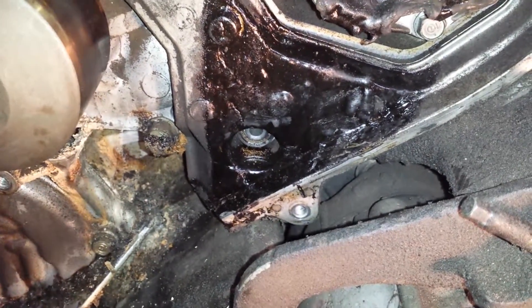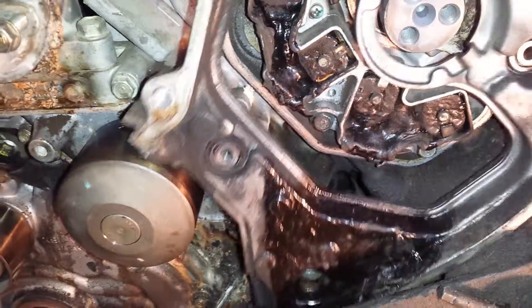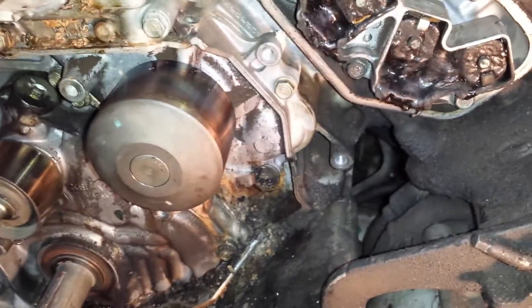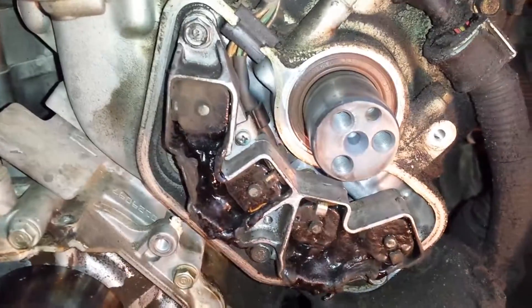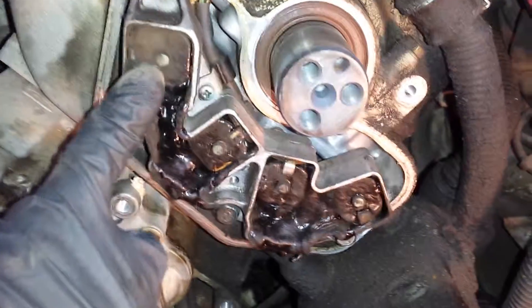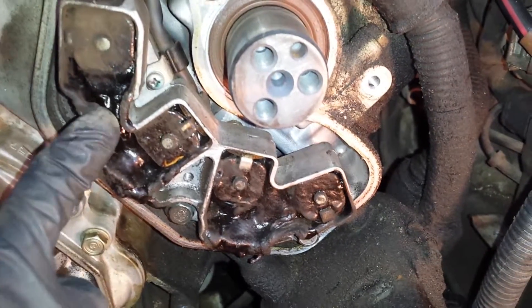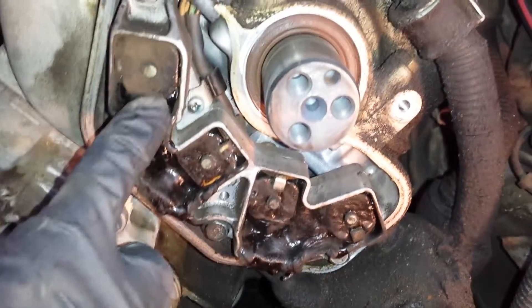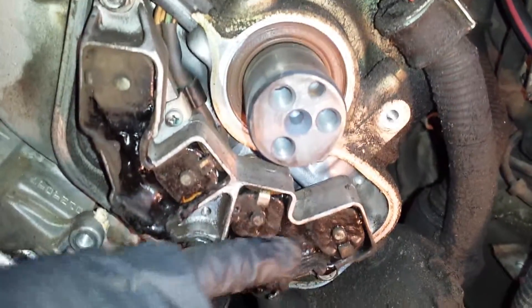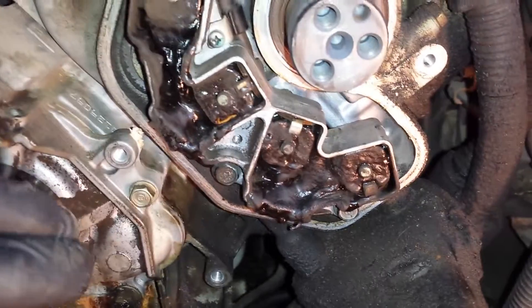You've got to take this cover or backing plate off, take the cam gear on this side off, then take this plate off to get the water pump off — it covers this bowl here. When I get the cam gear off, I see this pickup block, and I see this black potting material has melted out of there.